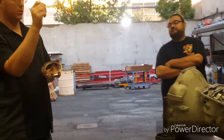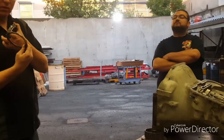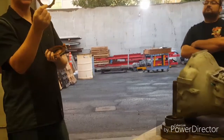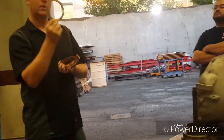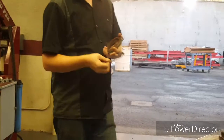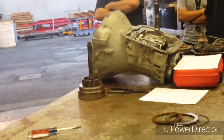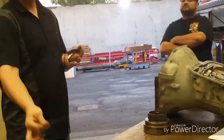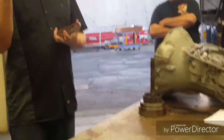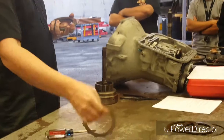This thing actually looks like it's never really been used — it's got most of its cross-hatching to it. Something else I often do when building a transmission for a customer car: the cross-hatching has this kind of irregular scuff all over it that helps it hold a little better. But if I'm building a customer's transmission, I like to know how flat the plates are. Around here, the flattest surface we have is actually the DCM — the head surface machine. The table it floats on is machined about as perfectly as you will ever find anything around this college.